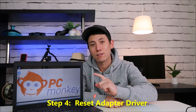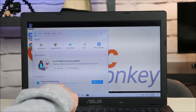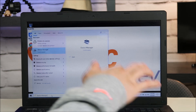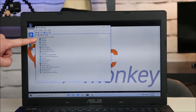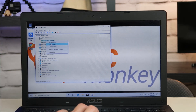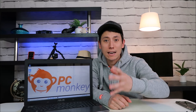After running your updates, if you're still getting these errors and your laptop battery is still not charging, we're going to try one more thing before we write it off as a bad battery. We're going to go after the driver for specifically that function. Go down to the bottom left of your screen, into your search bar, and type in Device Manager. Open Device Manager under Control Panel. On the left, expand Batteries, then right-click on Microsoft AC Adapter and hit Uninstall Device. After uninstalling that driver, restart your computer, then go back into updates to make sure they're processed — this resets the driver by uninstalling and reinstalling it.